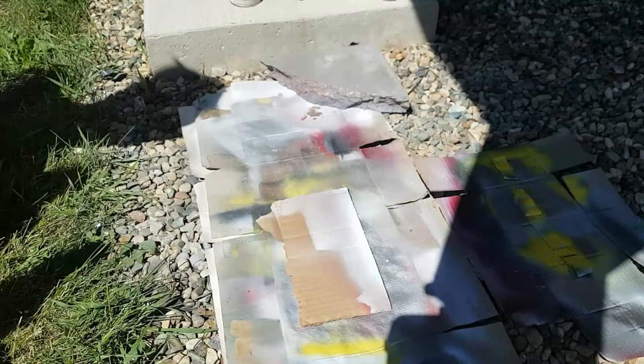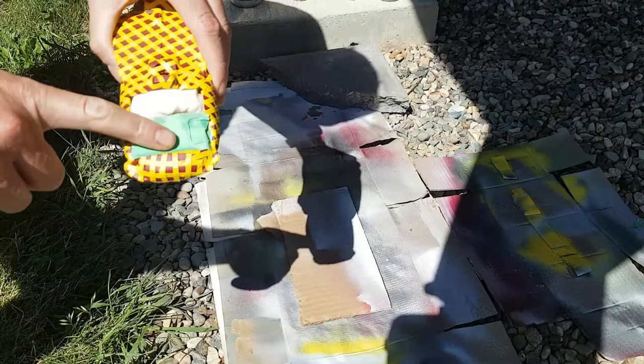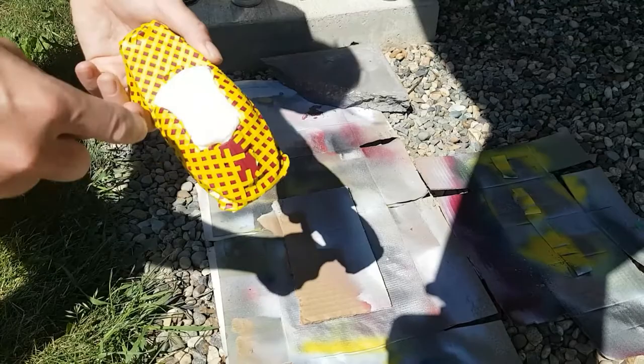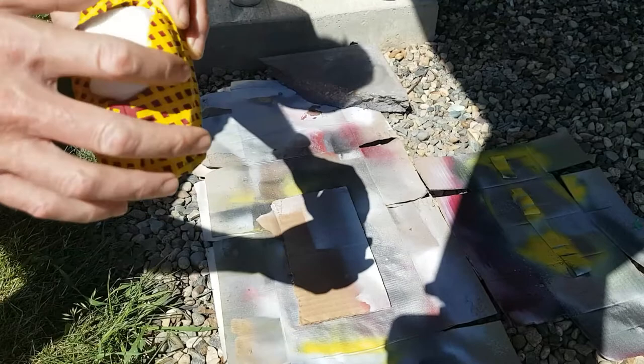If you don't have enough cardboard, let that paint dry before you set your vehicle on it. I've also prepped this — done the final preparations for painting. I've masked off this area here, which is where the skis go. In order to keep paint from getting into the cockpit — because I want to keep that the burgundy color — I've taken paper towel, dampened it, not soaked it, and jammed it in there. We don't want paint getting up in there, because then you'll just be chasing it back and forth.